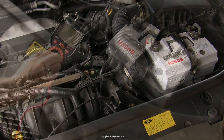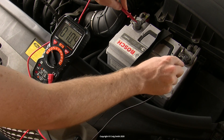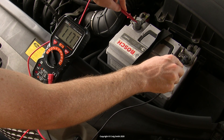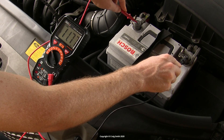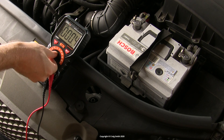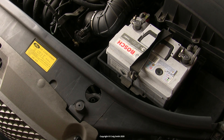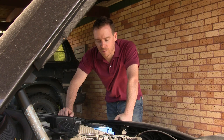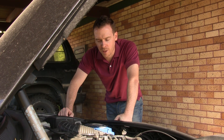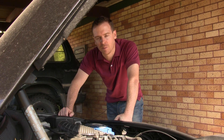If I stick a multimeter on this battery, you can see it is measuring quite flat. Anything below 12 volts is pretty empty, and this car was driven the previous day, meaning it should be charged and resting above 12.5 volts at least. So especially if your battery is old — mine was going on for seven years, which is well past the average lifespan of a typical lead-acid battery.